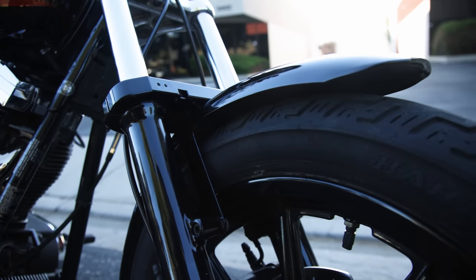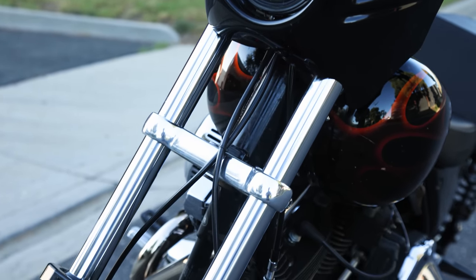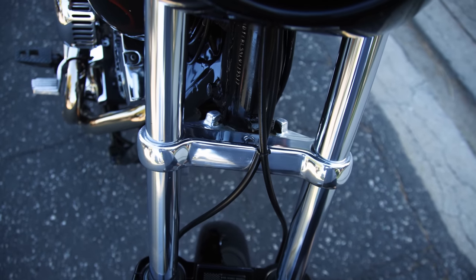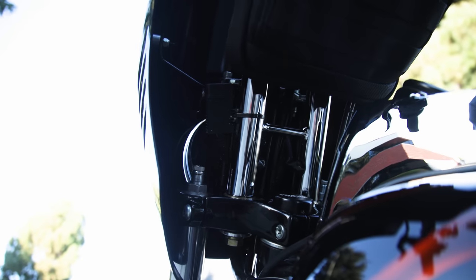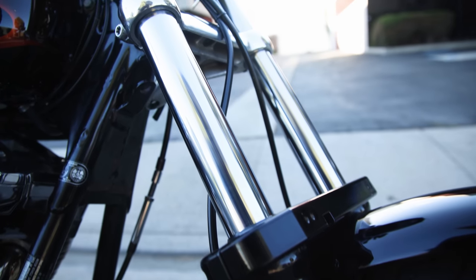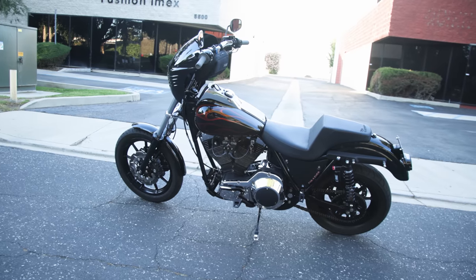This isn't actually the front end I built for the bike — I beat the original one up so I pulled this one off my Dyna. This is an FXDX front end built by Racetech, valved and sprung to my weight. Everything you can do inside a 39mm fork is done to that. The DX front end is about two and a half over stock, and I normally run two-inch drop trees with it. I usually run around three inches over in the front; right now I have the tube slid down in the tree, which is super sketchy.